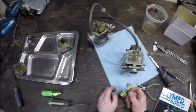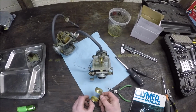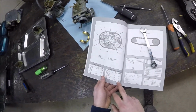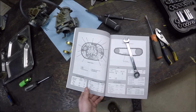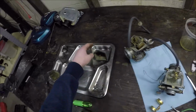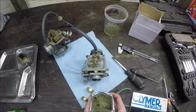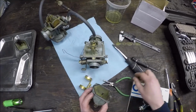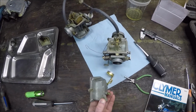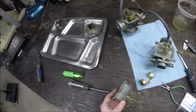I want to get it to about, and when we're at like 25.6, I want to get it to about 26 3/4. Now the spec said 26 for this one, but obviously I want to go more conservative, have it lower level in there. Hopefully we don't hit the overflow. The overflow works by, this is the bolt, this sits over the top like that, and once it hits a certain height, there's a tiny little hole there. Fuel goes into the hole, comes out and ruins your day under your engine. Or if you have the hoses, then it ruins the day of the floor.